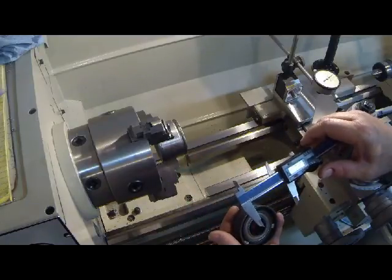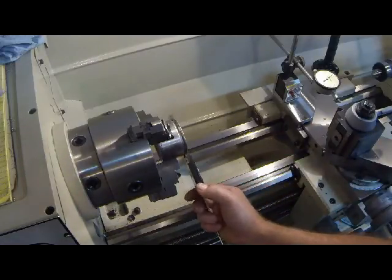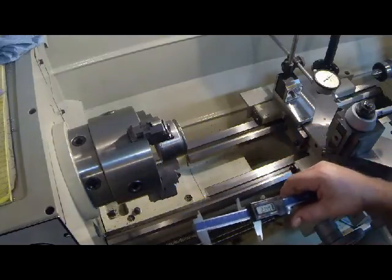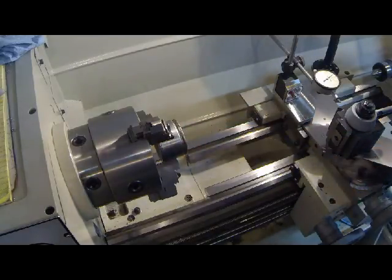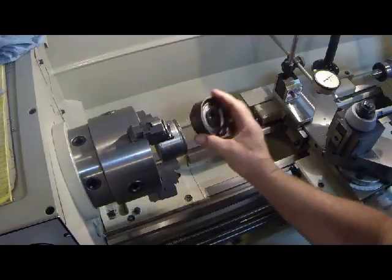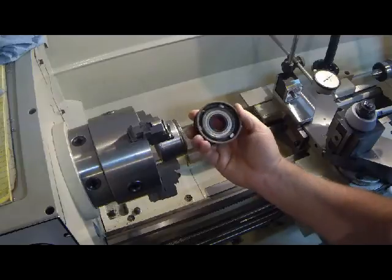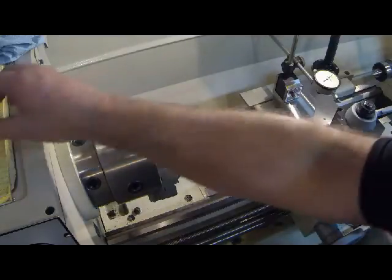So 2-inch 215 thousandths, and we are 2-inch 749 thousandths. So we can take this lip down, and it doesn't have to be too precise. We just want to fit this bearing sleeve or bearing assembly onto that, where we can hold these rivets in place to give us some substance to be able to buck that rivet. So let's give this a try here, see what we wind up with.